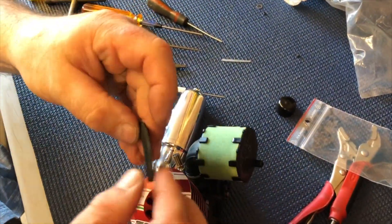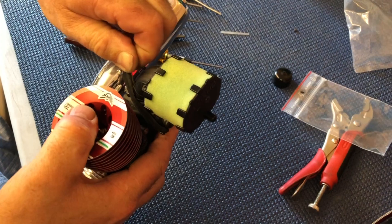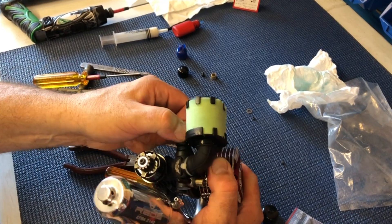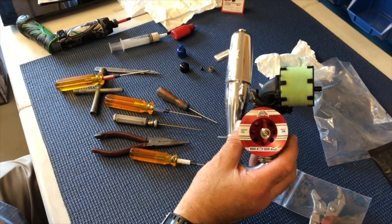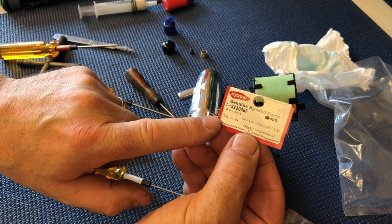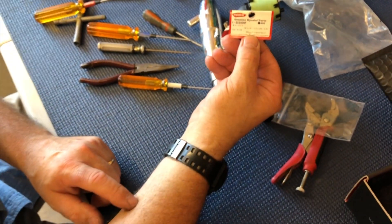Once you've done that, put your return spring or rubber back on — clip it over there, easy to do. Push it down around there, making sure it's not getting in the way of your fuel tubing, and you get a nice return. That's what you want when you're shutting the carburetor down. And now you have your nice Scuderia Reds engine all ready to go in your MP10. The part number for the cap screw with the washer is 1-S23006F — the 6 is the length, so you can get an 8mm which will work, but I like the 6mm, it's a bit safer. Thank you for watching, hope you enjoyed that and find it helpful.